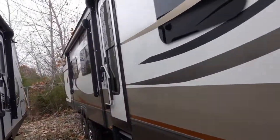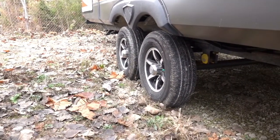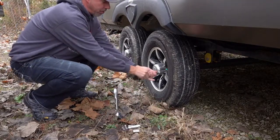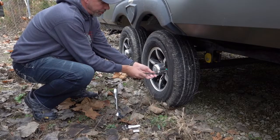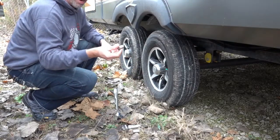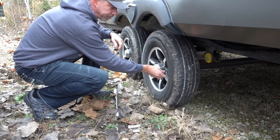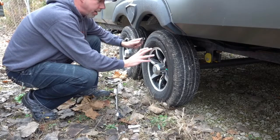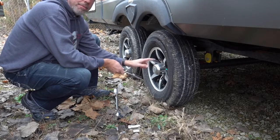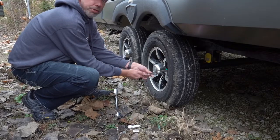So let's walk over here — I've got a couple of lug nuts that I've already broken loose, so I can just easily unscrew these with my hands. These lug nuts here are okay; they haven't expanded. I would suggest when replacing lug nuts, you do just two at a time. That way the wheel stays against the hub securely. I've got six lug nuts at each wheel, and if you replace two at a time that are opposing each other — say this one at 3 o'clock and this one at 9 o'clock — the wheel will stay secure when you use your torque wrench to tighten those down again.